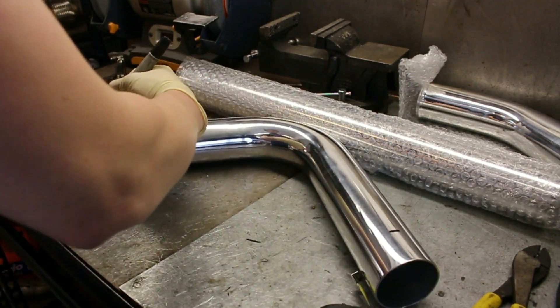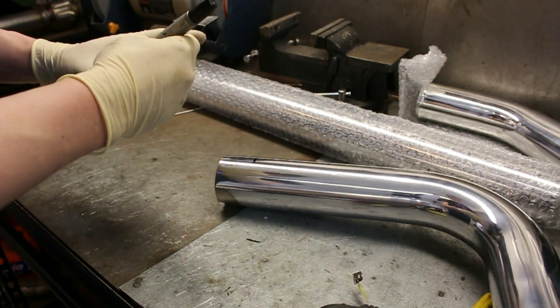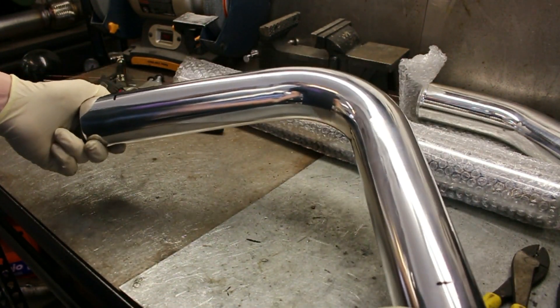If you want to make your own intercooler, I did a whole video on how to do that. If you order all the parts yourself, you can do the whole intercooler for under $250. It's a tested method — I run the exact setup on my own car and I've installed it on a couple of local friends' cars. When I had MassRP, I used to sell basically the same kit. We did 267 all-wheel horsepower on one with a big turbo. It was at the top of that intercooler's effectiveness, so it did need to go a little bigger, but it worked. There's no need to run a bigger intercooler than that if you're on a factory turbo or under 300 horsepower.